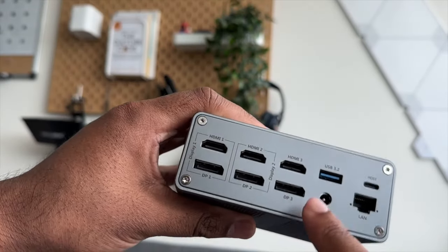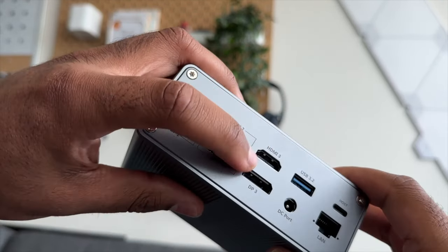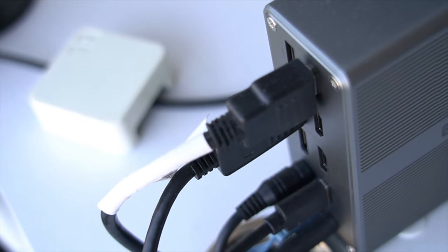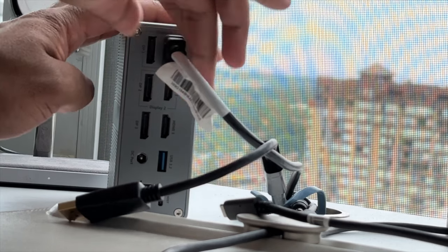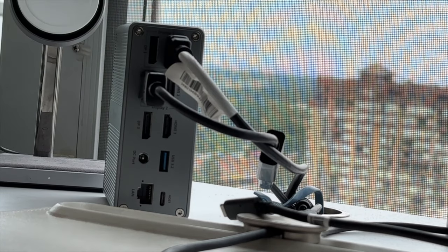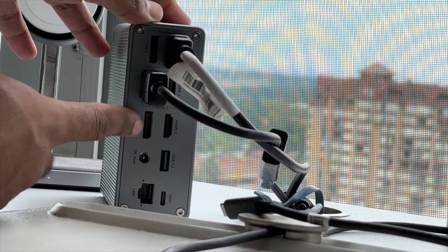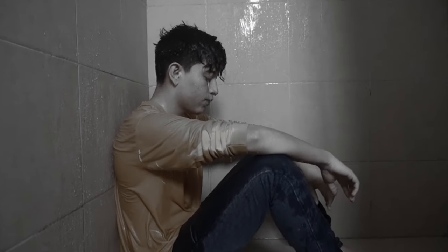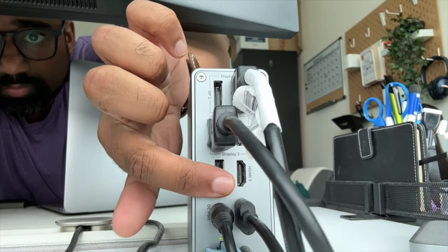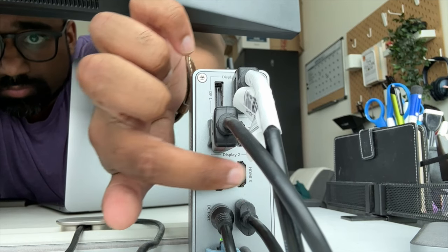At first glance it looks like we have six ports, but you can't really hook up six monitors. If you just have one monitor, I would recommend plugging it into just the HDMI or the DP port 3, because those ports are hardware-based and support single monitors up to 8K 30Hz. For multiple monitors, each display can be connected via HDMI or DisplayPort — the first monitor into Display 1, the second into Display 2, and the third into its own section. This is where the road ends for Mac users: you can only hook up three external monitors on a Mac, although Windows laptops that support it can utilize both ports on the last section for a total of four monitors.